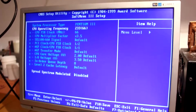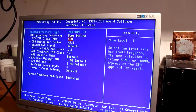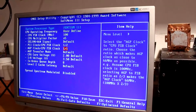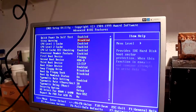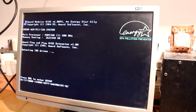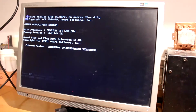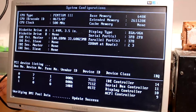Let's go into BIOS and check if we have cache enabled, and also set the CPU to 500 MHz. L2 cache is enabled. Let's reset and boot into the OS and see what happens. Our first indicator will basically be if Windows takes ages to load, then we don't have cache. Or if it doesn't load at all, which might also happen.